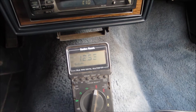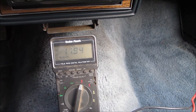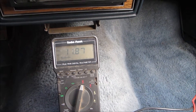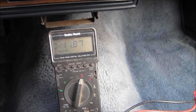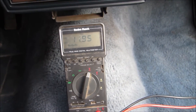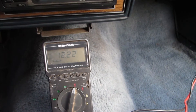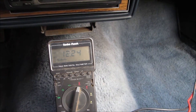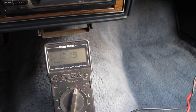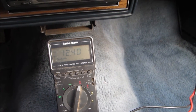I've got the new battery hooked up and I'm at 12.5 volts. If I turn the key on and hit it with the blower motor and lights, it pulls to 11.8 volts — which is great. Remember, the old battery pulled down to about 8 volts. You can see how quickly it recovers, right back up to 12.2 volts. With the key off it goes right up to 12.3 volts. Nice to have a new battery.